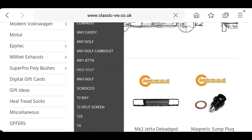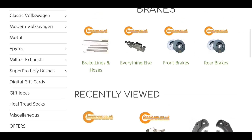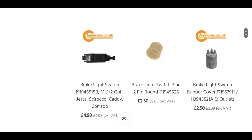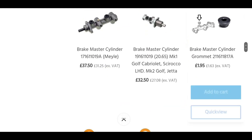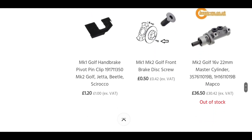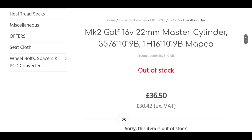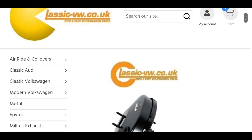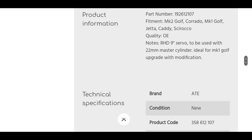For the brake servo, search Mark 2 Golf or Passat. On Classic VW they list the master cylinders — the stock Mark 1 one is 20.65mm, and the 16-valve one we're fitting is 22mm. Also out of stock but the part number is there so you can search other websites and local motor factors. For the 9-inch brake servo, you probably can't get these new anymore — you can get patterned parts or used parts. Try the likes of Brendan Moss at DubStock where you can source these parts.